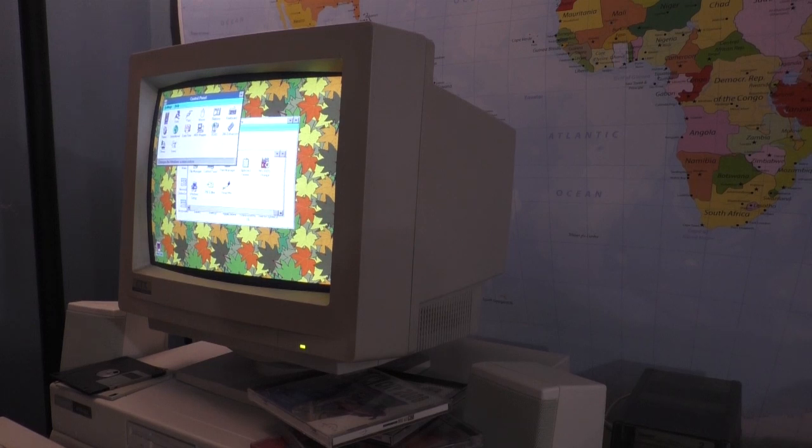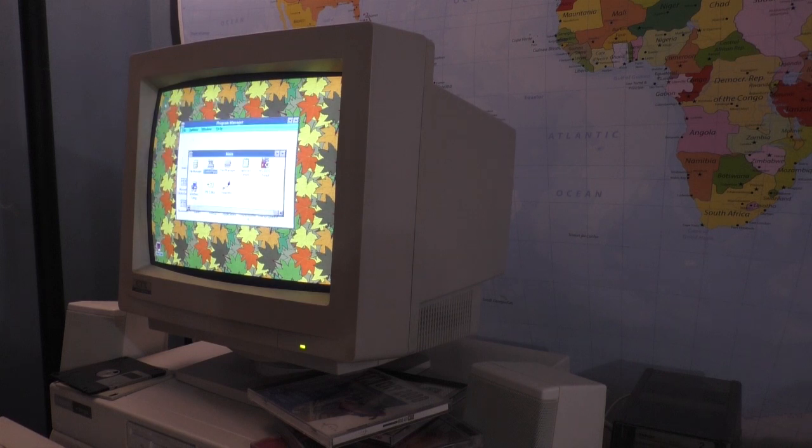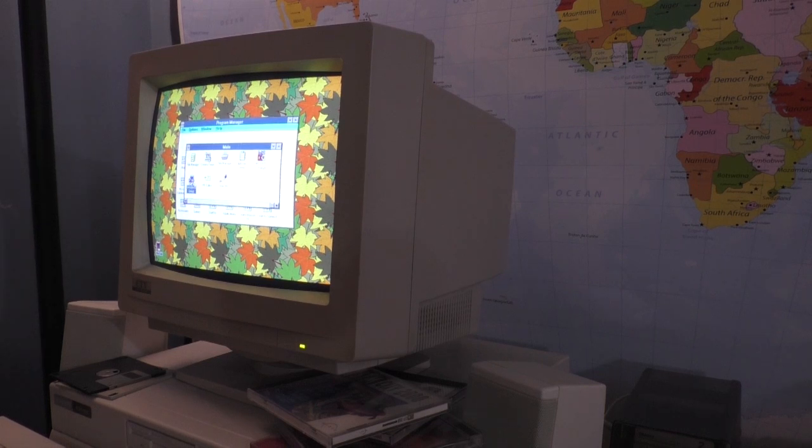Let's take a look. Where are we? In the wrong control panel. Up. I got dots everywhere. Oh, crap. Yeah, there's a problem with that card, for sure. I'm thinking bad video RAM. And one way to tell is, I can start pulling those RAM chips out one at a time until this clears up, although I'm not sure if it'll run with one of them.